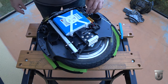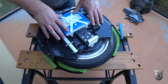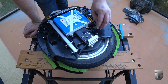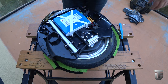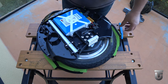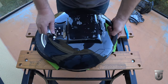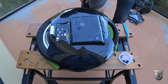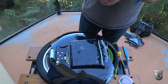While we don't have to remove the battery in this particular exercise, be aware there are a number of small rubber blocks positioned around the battery holding the wiring in place — these are semi-adhesive. Depending on what you're disconnecting or moving, they may come out, but they can easily be put back anywhere they need to be to keep everything nice and tight. The battery itself is fairly robust but it is more exposed than normal, so take extra care while working on the wheel. We need to turn it over now to do the whole cover removal again from the other side. As we remove the LED rings, the connectors just push together and pull apart, so as you lift it out you should be able to find and remove them quite easily.